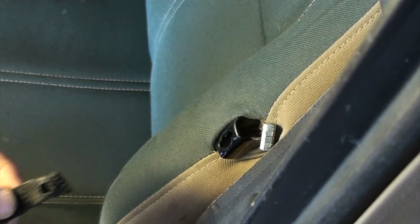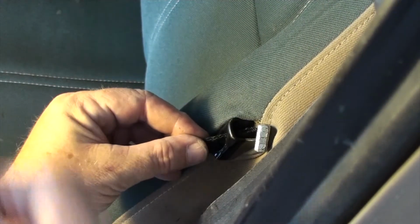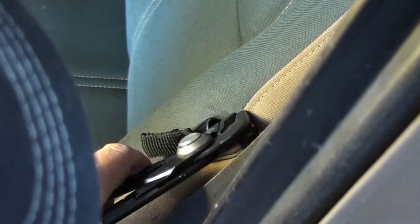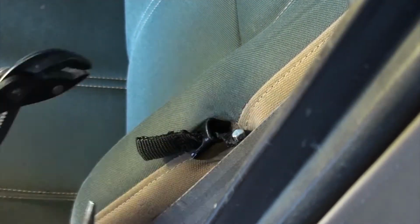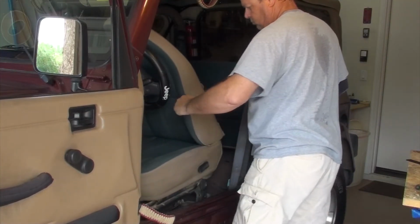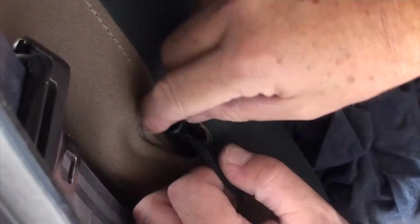Attaching the modified strap was the hard part. We first exposed the metal T-clip, then fit the clip into the hole we made on the strap, without the clip falling back behind the bracket. This took some finagling, but we finally got it. Super slow-mo. Nice. Then we repeated the process for the passenger side front seat.